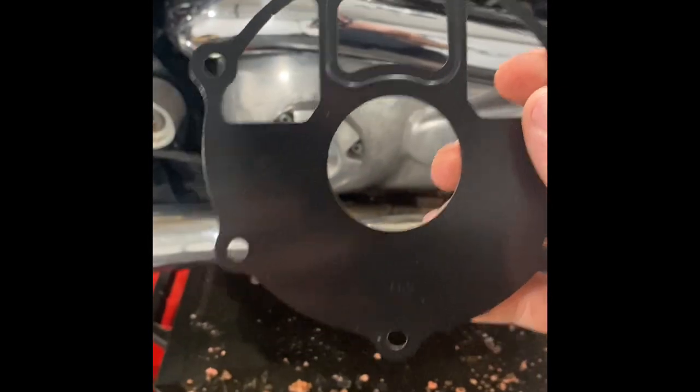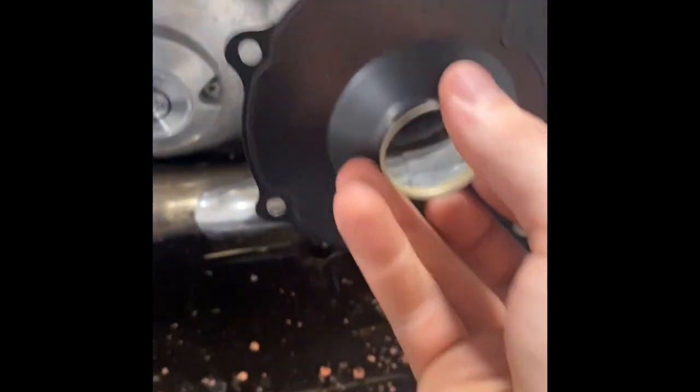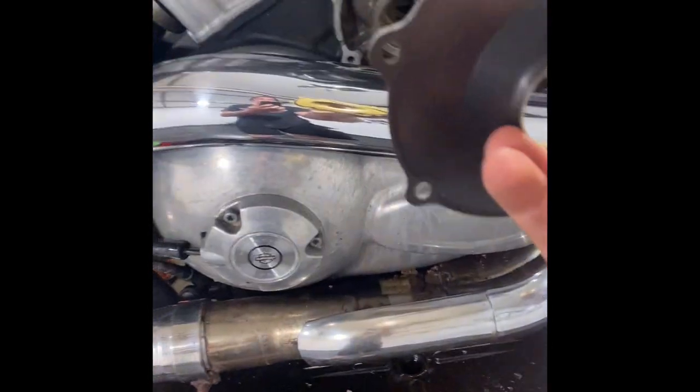Now we're on to installing our actual pump. First, you have the back gasket here, and you can put it on either way, okay? But you see that raised portion with all of its part numbers and lettering? That on the gasket faces away from the engine block, so you should be able to see the part numbers. We put it on there, and then we're going to throw on the water pump. Then obviously the outer gasket goes on black side towards the outside, so that your propeller is not hitting your gasket surface right in there. Then torque spec is 86 inch pounds on this. So let's slap it in there.